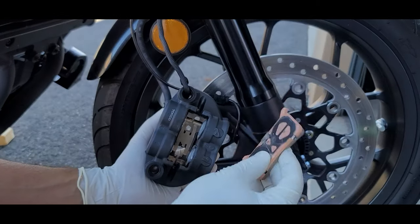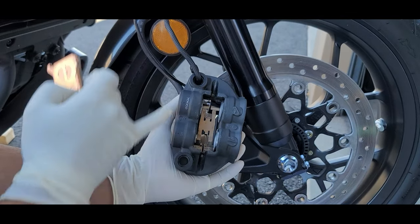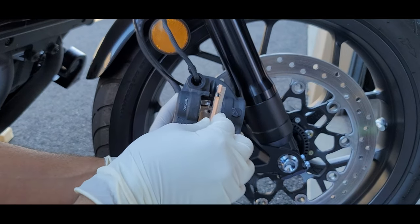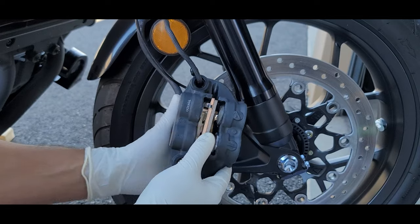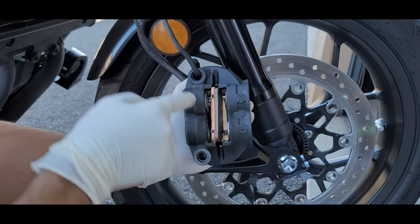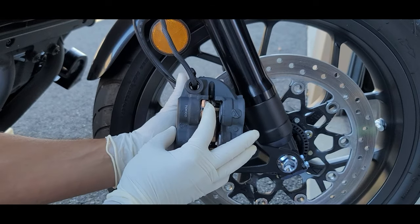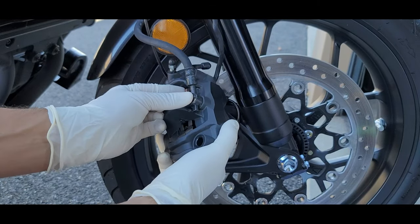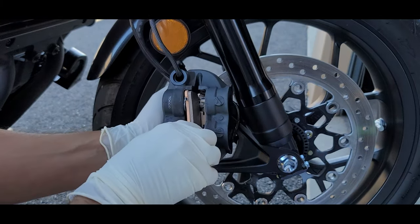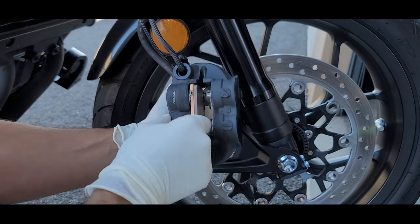It's time to install the new brake pads. We're going to start off with this side — it's in reverse of how we took them off. Start off with the side where the bolts are, and you're going to be pushing it in the middle, all the way down, and then sliding it over to its final position. Now there is a spring in the rear that you're going to have to compress a little bit and you can use your finger on the other side to help you. And the brake pad is in position.